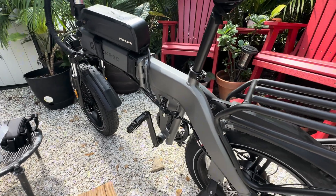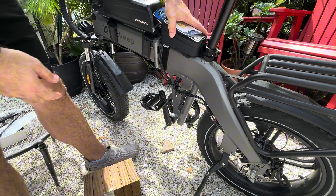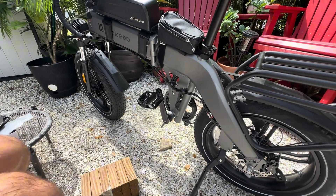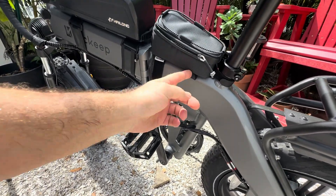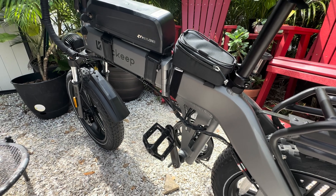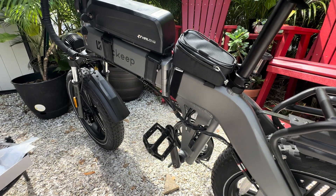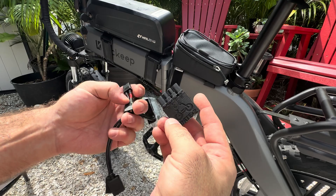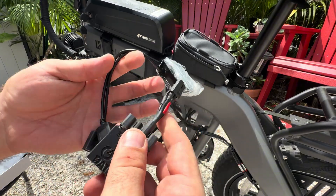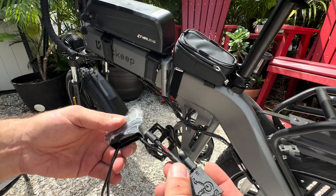For the DX2 installation — that's our cell phone bag strapped in. I only used one of the straps, so you do have the other one. I'm going to open this up and replace the 40-amp balancer with a DX2. With that, we will use this accessory to plug into an output of the DX2. If you don't have a second motor, you can use that output port for USB accessories — there are two USB plugs. We'll leave a link in the description below.